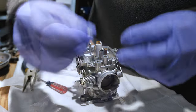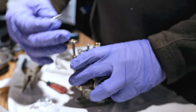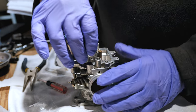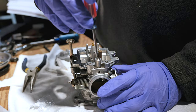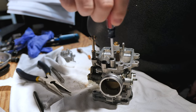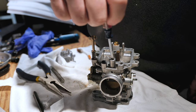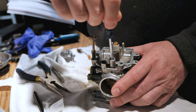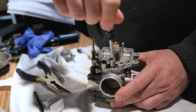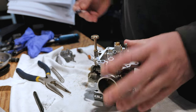The spring can go in. The spring sits on the idle jet like that and goes into that same hole. Put the spring in first, then put that piece in, and this screws down. It's screwing in nice and easily, so I know it's in the correct position, not meeting any resistance to speak of. Looking at previous carbs, as this screws down you'll see some threads inside become evident. Most of the carbs I've seen, it looks to be about four threads in to get the correct idle. These will have to be adjusted when it's on the bike.